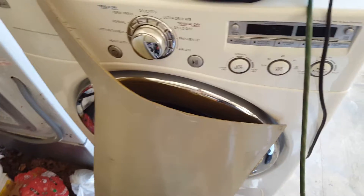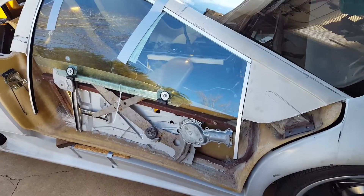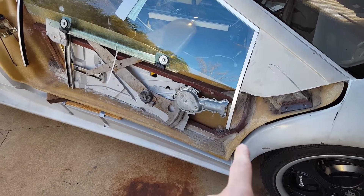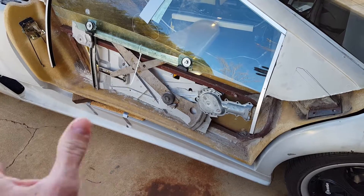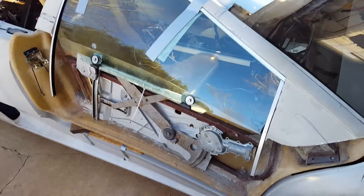So I've got a separate door skin, which is here. There is a way to get that bottom skin back in the exact same position by having those bottom spots drilled and riveted along through there. When we go to put the skin back on, it'll line right back up exactly where it was previously and there's no time wasted messing around trying to figure that out.